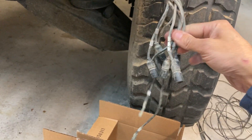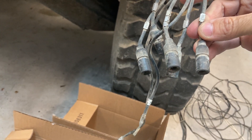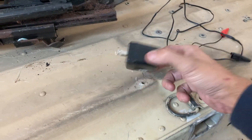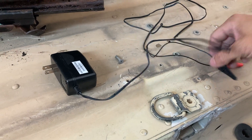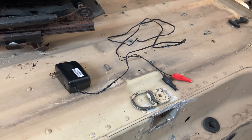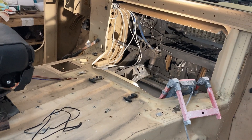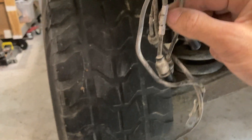These are all the original wire connections for the running lights and taillights on the truck. I left the end connections on them and they're all individually labeled — you can see that one's like '23 delta.' With each of those, I was able to make a 12-volt tester — basically a phone charger or, in this case, a router adapter that says 12-volt output. Using a voltmeter, I was able to find which was the power line, which was the return, and put some alligator clips on it. That way I can apply 12-volt power to any lights or wires I want to test and identify, without blowing them up or putting too much voltage to them.